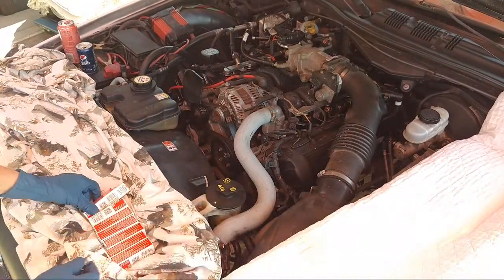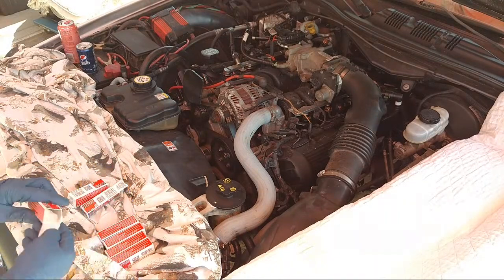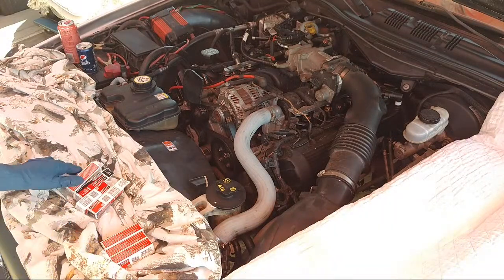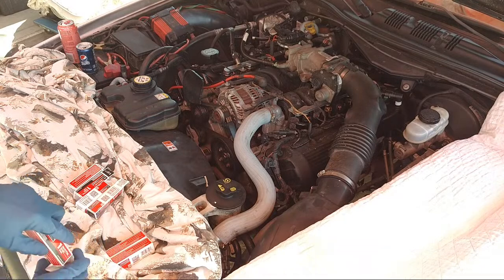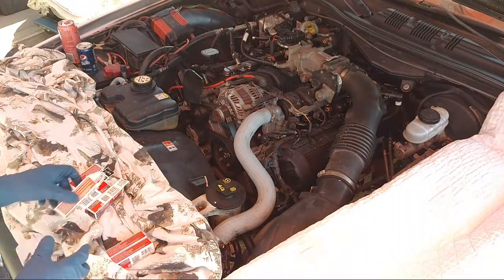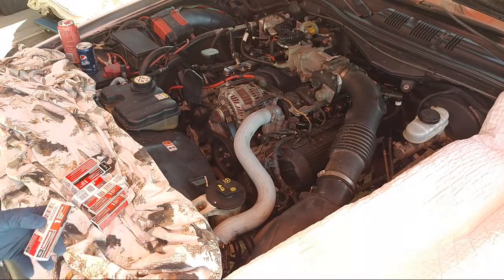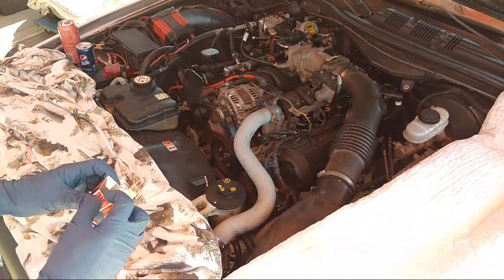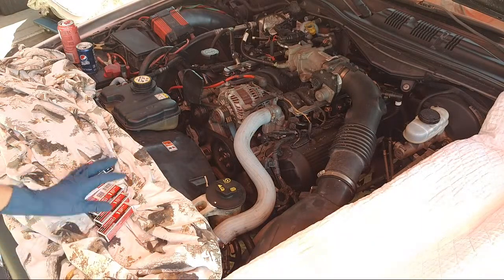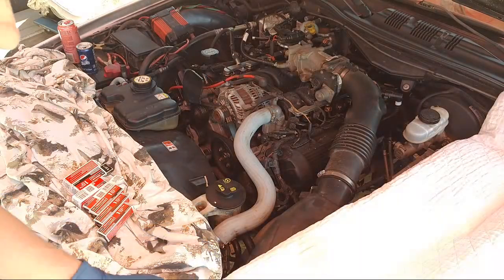Alright, let's get my plugs out. And they should be gapped, probably 050, so 0.050 usually. It's a pretty big gap. But we'll confirm. Oh, and these are platinum. Yeah, we'll still make sure, but I could check visually and see, and they're probably all flawless. But always check the gaps before you throw them in. You never know. One could have been taken out of the package and dropped. So always check all your plugs, and really you gap them. So let's see what we got here. Flawless.